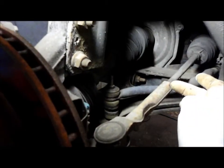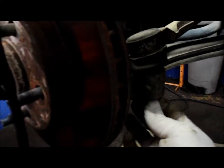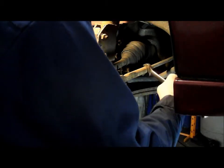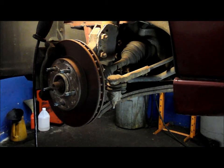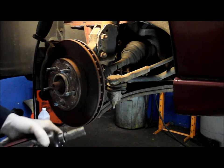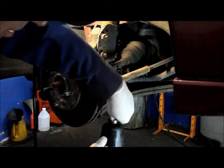The way you're going to do it is you're going to break this nut loose right here — loosen this one up, you're not going to take it off, just crack it loose. Then we're going to take this nut out right here, which is probably going to be about an 18 millimeter. Next thing we're going to do is loosen that nut in the back that actually holds the inner to the outer tie rod. Then take off the nut on the bottom. You can remove it with a ratchet or with an air gun — just to save time, I'm going to do it with an air gun.